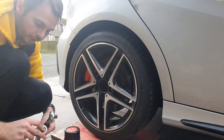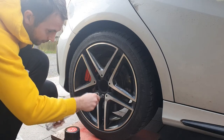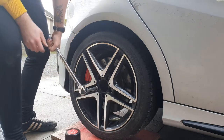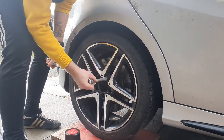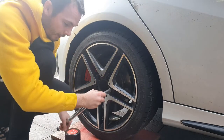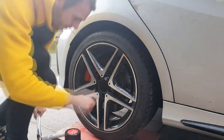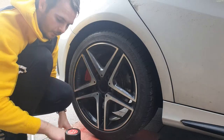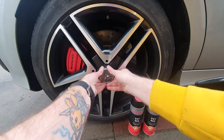So I've got my torque wrench out - 120 is what I usually set my wheels to. Someone can tell me in the comments below, but always check your manufacturer's spec. I'm going to stick these to 120, so it's just a case of torquing these to spec - I always do two clicks just to make sure. I've been known for my wheels to fall off in my younger days. So I never tighten the centre one too tight because it needs to come back off - four bolts will hold it. There's nothing worse than when these get wrecked because it means you can never get your wheel off. I gave the wheel a wee clean to get a nice thumbnail picture - last step is literally just popping the centre cap on and that's us sorted.